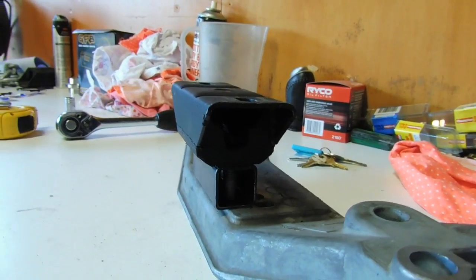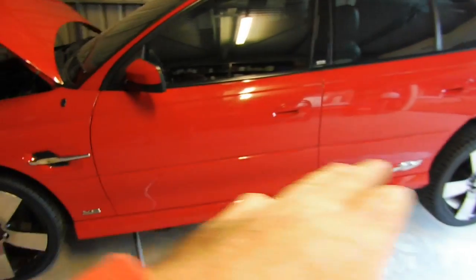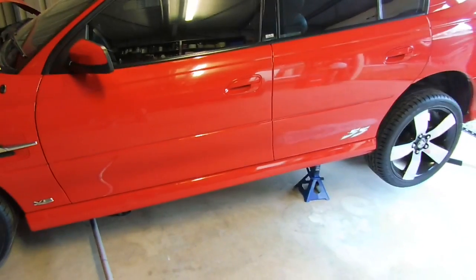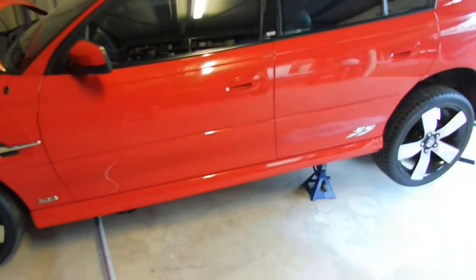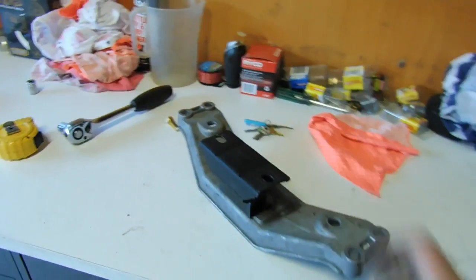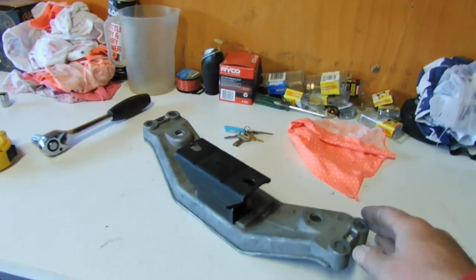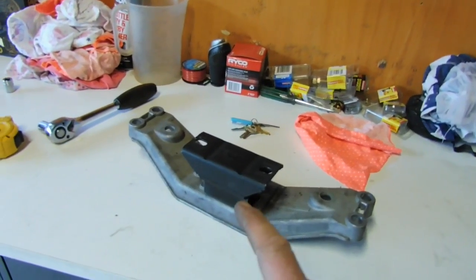But I'm not really going to rush into that because I have been speaking to my tail shaft guy, and we are considering putting a single piece shaft in it. Now this has got a 2-piece with the centre bearing at the moment, and we're just going to toy with the idea. We've been talking about it. We're looking at putting a single piece in, get rid of that centre bearing. Now nothing's set in stone yet, but there is the possibility with the single piece that the gearbox might have to be raised or lowered for certain universal angles and to make all the synchronisation of the unis work and all this. We'll go through that in probably the next video, but I'm not going to finalise this cross member.